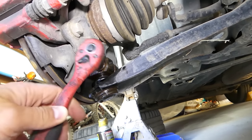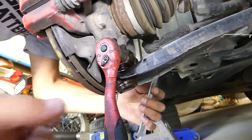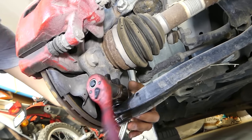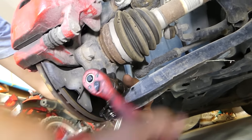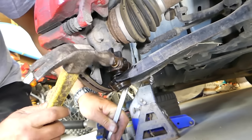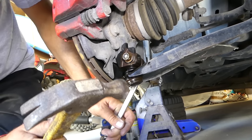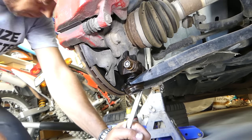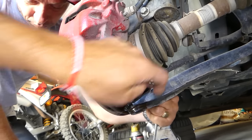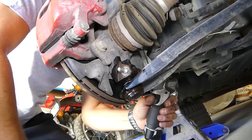Next, get the bolt for the ball joint on the control arm. On this side it's a 15mm nut; on the other side it's 13mm. Get it loose, and before the nut comes all the way off, hit the bolt with a hammer. If it's stuck badly, spray more penetrating oil between the two parts. You can also try unscrewing it from the back side with a 13mm.